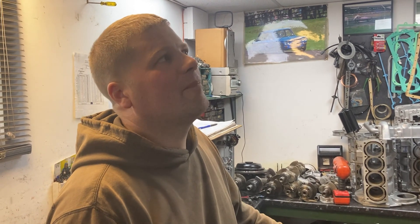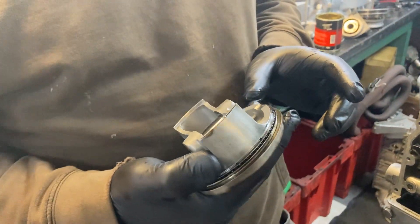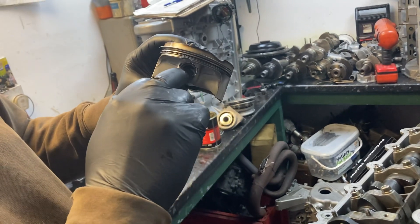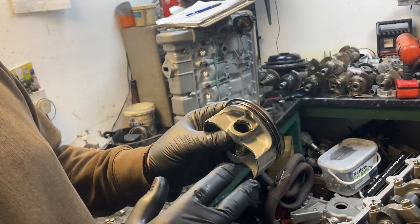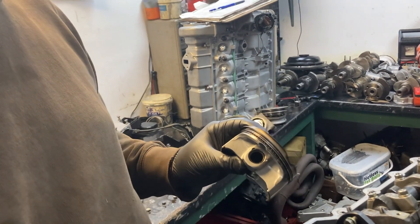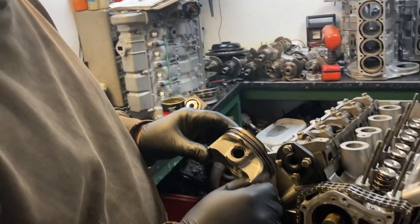We did yeah on the short piston. These are actually the pistons - there's the new box - these are the ones you've put in, these are the ones that came out. What's the difference from a standard M42 piston? It's a really short compression height - the pin is really high in the piston and it's a near two-ring piston as well. It's a proper race piston, a forged piston, but with putting it on the 90mm stroke diesel crank we didn't want the rod-to-stroke ratio to get too low.